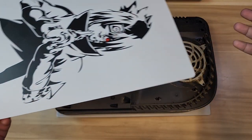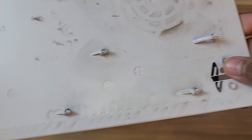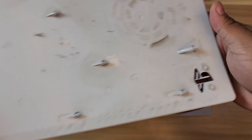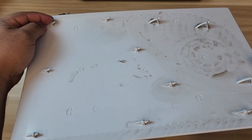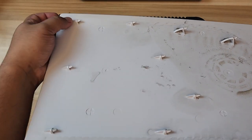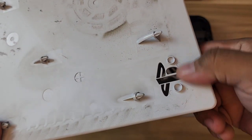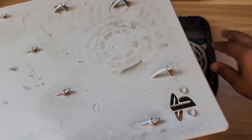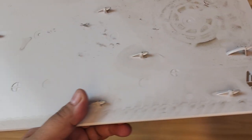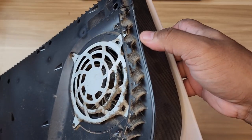We got that. These two little knobs here are kind of like the lock for it, and everything else is the clips - the locking mechanism. You don't want to just pull it outwards because you might break the pointy little things, especially the bigger ones. Just pull it vertically first, and then once it's dislodged you can swipe it downwards like so.